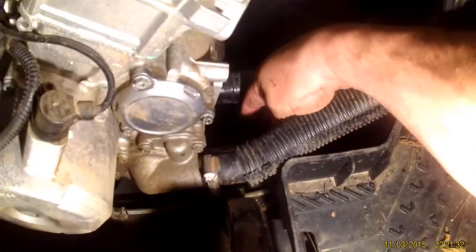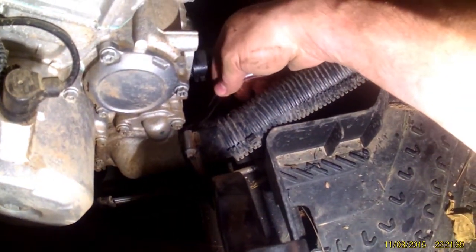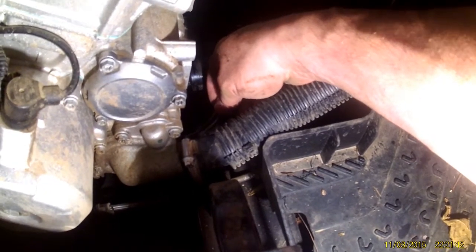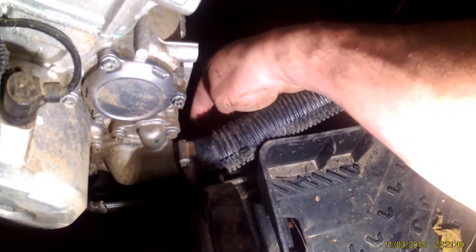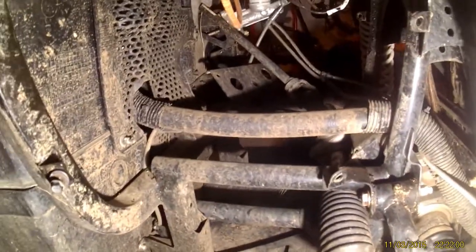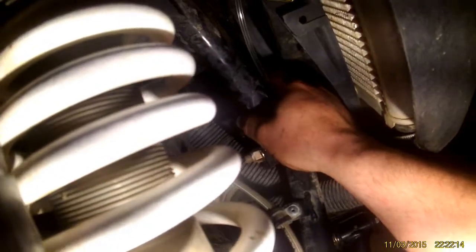Underneath here is the water pump — it's way down here. You're going to see a little tiny piece of hose sticking out; it's very small. You're going to pull that off and use the differential-type tubing, hook it on, and wind it up to pop it out at the top. For the front differential — which is on the other side — here is the hose for the radiator. It hooks in right there and there are a couple of little plastic clips where it feeds through. Pull it in tight.